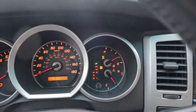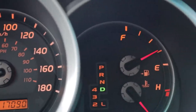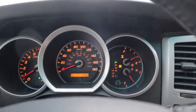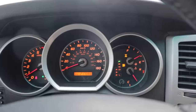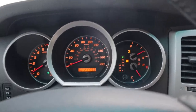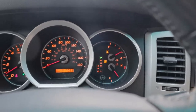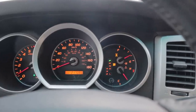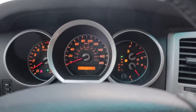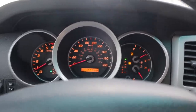Now, all of these things, whether it's the four low or the center diff lock, when they engage, you'll see that the lights come on the dash. You'll know they're engaged. Now, if they're not engaging, then those lights are going to be flashing. And that tells you that it didn't go as planned and you didn't get what you wanted. And that's not the end of the world. Sometimes it'll do that if you're on kind of uneven ground, or it's as simple as you just got to roll the vehicle forward like a foot, and try it again. And usually that'll be whatever it takes. Anytime that I've had trouble getting into either of these four-wheel drive modes, it's just a matter of pulling up a little bit and they'll all engage then. If you've tried everything, and you've tried shifting it in and out, you've tried neutral, you've tried moving forward a bit, you got yourself on level ground, and it still isn't engaging, I'm sorry to say, I think you might have a problem. But hopefully that's not the case for you.